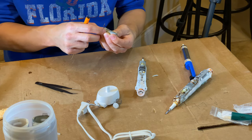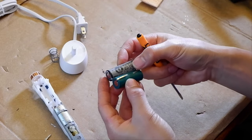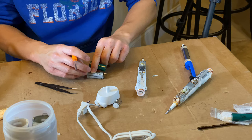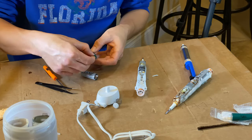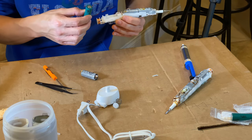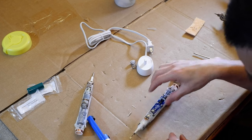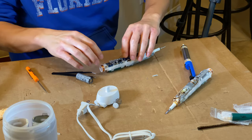On this one, you'll notice the positive terminal has a weird angle to it, so you're going to have to bend your new battery's lead the same way to get it in correctly. Interestingly, the replacement battery appears to be made by the OEM manufacturer — the back of the new one has the same HR logo. Copy the same bends for your new one, then line them up through the same holes and fish them through. Make sure everything is lined up correctly on both sides, top and bottom — you should have plenty of clearance.